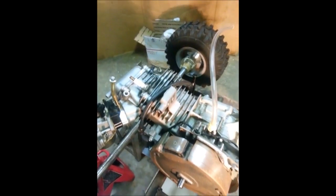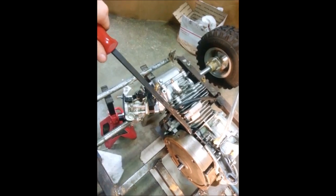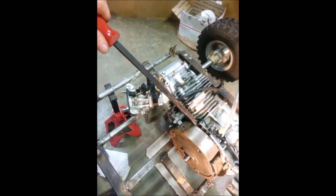Let's turn this first — it makes it easier without sticking because that's a pretty strong magnet. That's what sets your spark. Set the pry bar behind the flywheel and give it some prying action — just apply some prying force, a little, not too much.